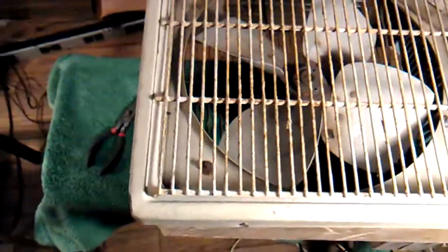In any case, this used to be a condenser fan for probably a two-ton or a three-ton central air unit. It was 220 volts, now it's 110. It was single speed, now it has two speeds.